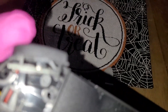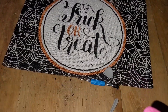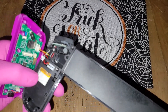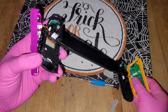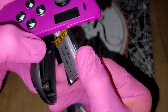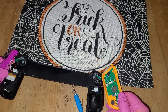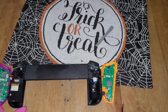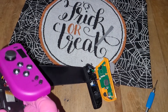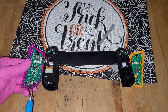We can see that there's the micro switch for the shoulder buttons right there, and there is the ribbon that connects the two sides. Chilling right there is the battery — I presume it is a 400mAh, 1.48 watt hours, and they're all 3.7 volts. The rumble on this side is chilling there. The rumble on this side I think is gonna be this right here.